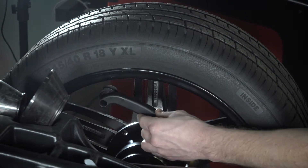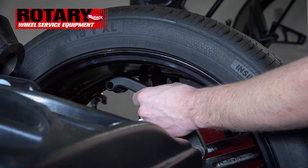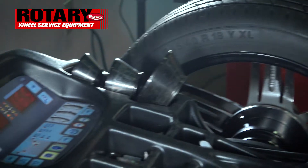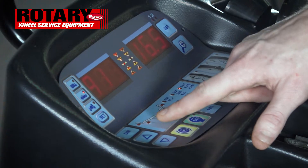Your first step is to place it just inside where the first weight will go, then pull it back to where the second weight will go. Pull it back. As you see, the program automatically — with the red lights — goes to stick-on, stick-on.